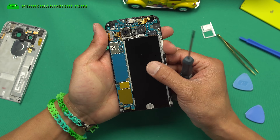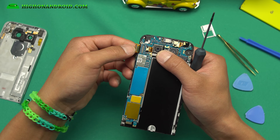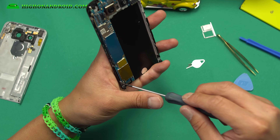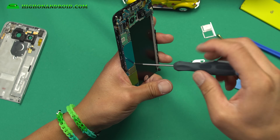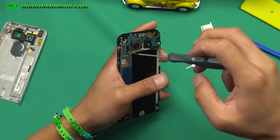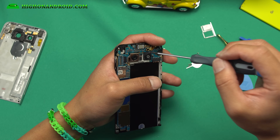The rest of it is super easy. You just need to remove six screws. Before you move these screws, go ahead and undo the LCD connector and also undo the connector to the main camera. While Samsung is really focusing on design, their glass back makes it very hard to repair, especially with the Galaxy S7. That is one of the reasons why I didn't disassemble it — I only really disassemble phones that I can reassemble and make function 100%, but that one you really can't.